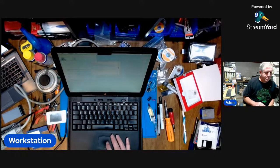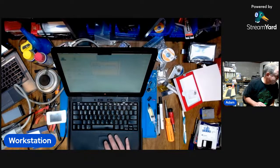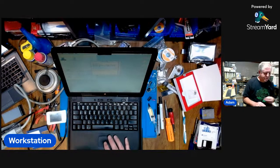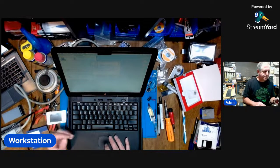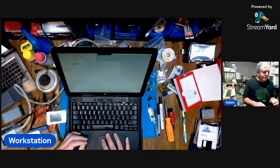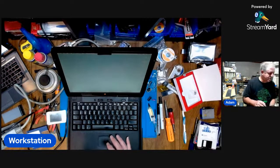Drive setup doesn't support it. It's not grayed out. It just doesn't have a pop-up at all. It just says DOS is the only format. So I have to use zip tools, but I'd probably be better off formatting these on my G4 that has all that stuff installed on it, and then just use them on here instead of glomming this up with a bunch of iOmega junk.